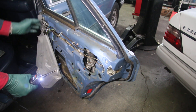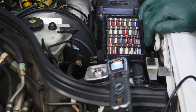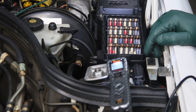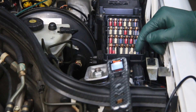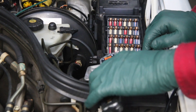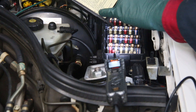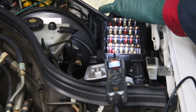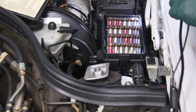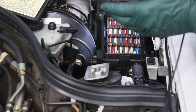Right away I know my motor is good, so I've got to start looking elsewhere. Now let's go to the other car with the memory power seat problem. Anytime you're troubleshooting an electrical component, look at the fuse box — but in this case you need to do more than just look, you need to test. I'm going to test the fuse and circuit for the memory seat on the driver's side. Looking at the chart in the fuse box lid, the driver's seat with memory is fuse E. I touch the probe to it and there's no power.